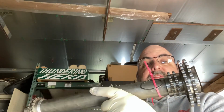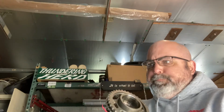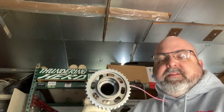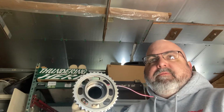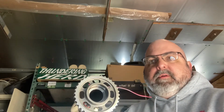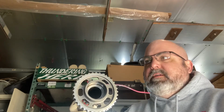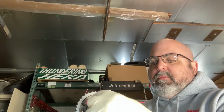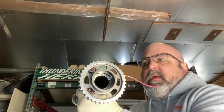Thoughts were that I was not going to purchase a bearing from any of the parts places that think that it's a Porsche IMS bearing, rather from, you know, a Timken or something, just using the bearing number, and probably pick one up for maybe $15 instead of $189. I would need to redo the triple seal, which we'll go over later in the video.